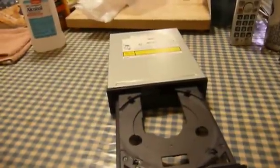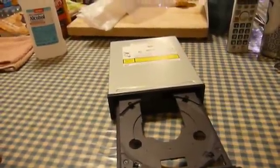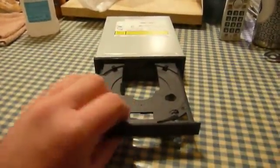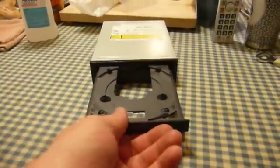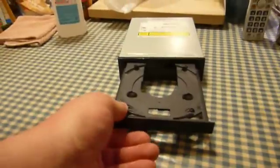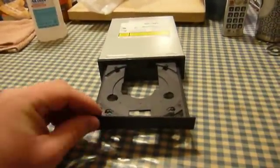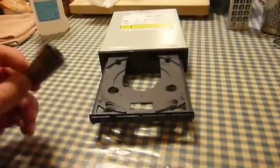If the tray won't come out, you may have to do this with the tray closed, and it's doable, but it's a lot more difficult. Now when you've got the tray out, you need to take the front bezel off. Basically the way you do this is you pivot up at the bottom, just easing it over a set of locking tabs, and then it lifts up and away.